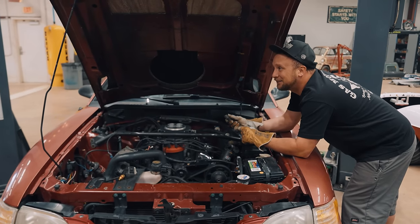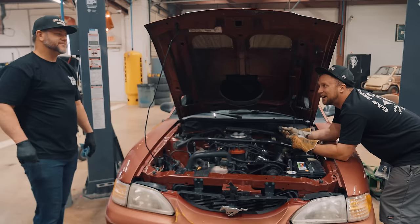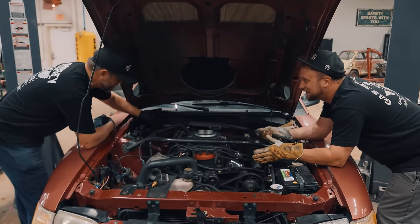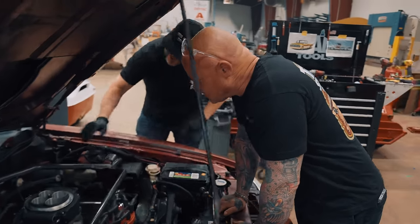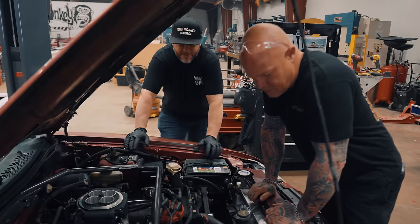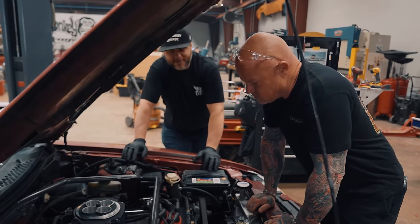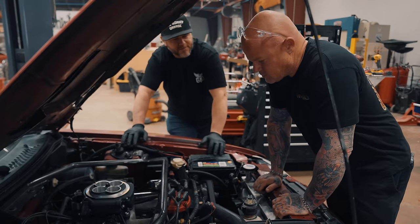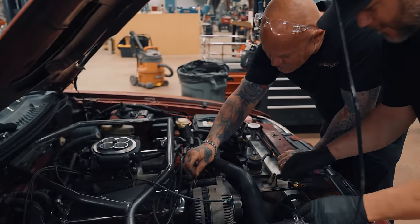I'm ready to ride in a minute, see what the power difference is. You can drive it too — will you drive a mustang? No, I said I'll ride in it — okay, that's about as far as you're gonna get me. Now he's doing the Sniper — what do you think about that? Is it supposed to be on that spacer? I already had the spacer, but yeah, I definitely want to run it for the Sniper because I have a dual plane intake and the guys who had the best luck were running single plane — that's going to help me get farther away from the split. Makes sense.